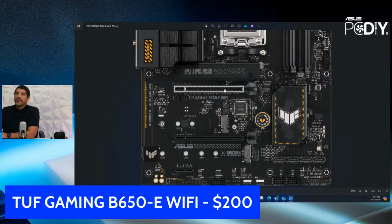Now this primary slot, we did go ahead and revise that. Compared to a higher end X670 board, where you might have PCI Express Gen 5 for both the PCI Express slot and the M.2, this one is only going to be PCI Express Gen 4. But keep in mind, right now there's no graphics cards on the market that use PCI Express Gen 5, and even right now, there's no need for it. Even an ultra high-end 7900 XTX or 4090 really only effectively uses about the bandwidth of a PCI Express Gen 4 by 8, not even a by 16 level of PCI throughput. So it's actually more than enough even for ultra future higher-end graphics cards, and you still have that support for the absolute fastest M.2 SSDs if you want to take advantage for the future with things like DirectStorage. So you have that on there.